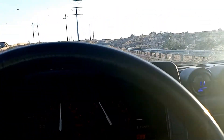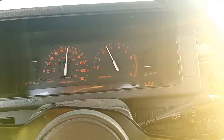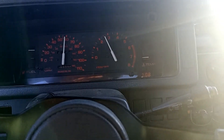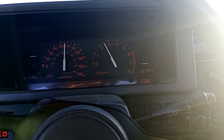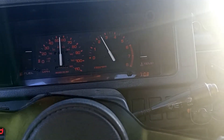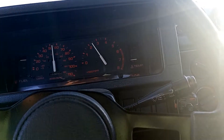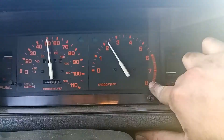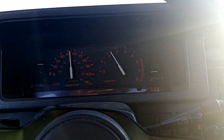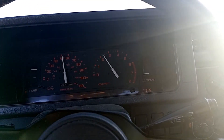I've got a whole kit for it. Once I get the secondary emulsion tube out, it'll be a lot better — I could put in a bigger main jet and a bigger idle circuit. But I really just want this engine to do what it needs to do at higher RPMs. I'm hoping to grind down the camshaft to get it to rev all the way to 8,000 RPMs without any problems. I know I'll need billet rocker arms eventually — that's way in the future, probably not this season — but B2K all day.